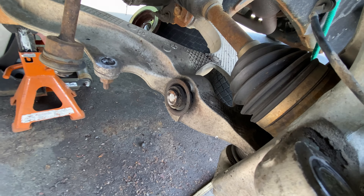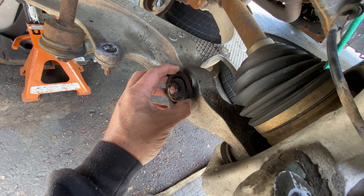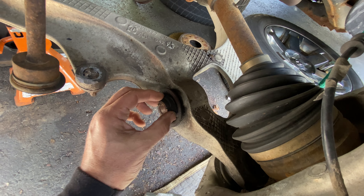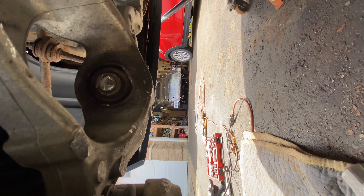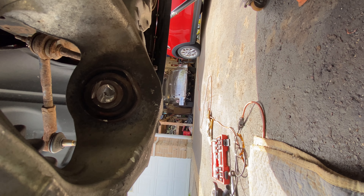I've had a slight change of plan. I'm going to try and push the rubber bushing out of the sleeve first, because it's very difficult to get a collar around the whole thing. If I can push the insert out first, then I could probably bash the sleeve out. I accidentally hit it once and it bent in quite easily, so I might be able to just tap the whole thing out with a hammer and chisel. Famous last words — we'll give it a shot.